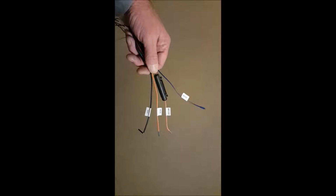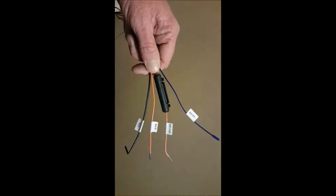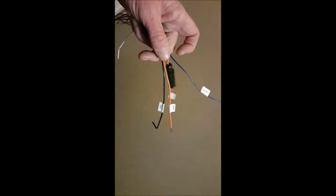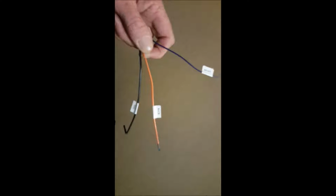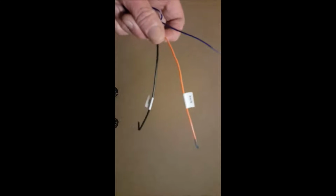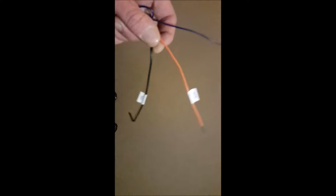Enjoy it. Something as an afterthought, the amp continuous cable, you don't need to connect up unless you're running an amplifier through your car, and I'll be honest, I can't give you much information on that because I'm not doing it. Your back wire, as I mentioned previously, is the one that you connect into the reversing camera. Now you will need to connect your ground, so find somewhere to connect it down to.